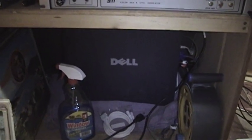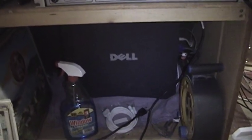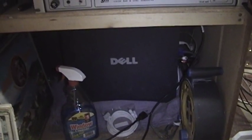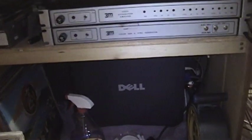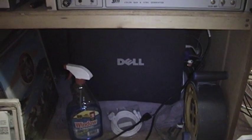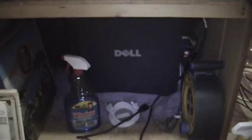I've never had a computer power supply blow up on me in an exciting way, except for one time. I had a customer's computer sitting down here, was fixing a routine problem with it, and all of a sudden — POP! Sounded like a gunshot. And it just went completely dead. So I popped the power supply open, just out of morbid curiosity, thinking a cap had gone. No. The controller chip had a big old brown hole blown in it, and there were pieces of the chip embedded in the top cover of the power supply. Fun stuff! So I think you can understand why I'm not thrilled about goofing around with these.